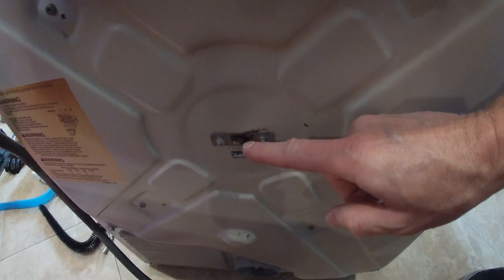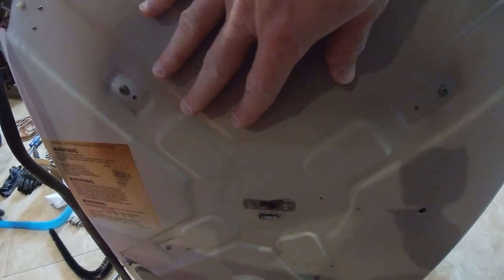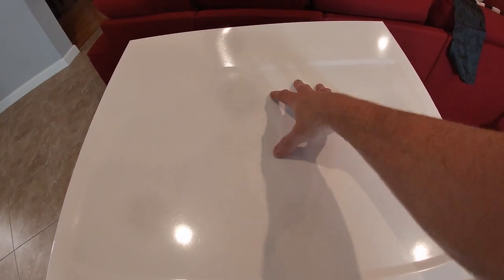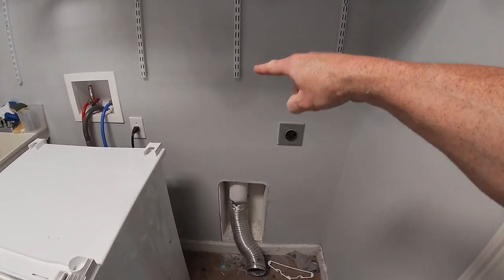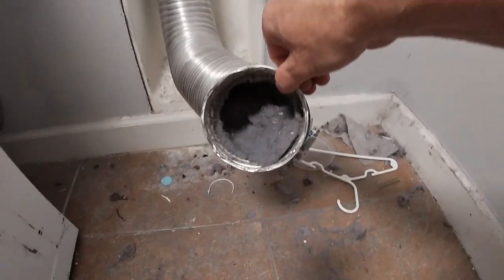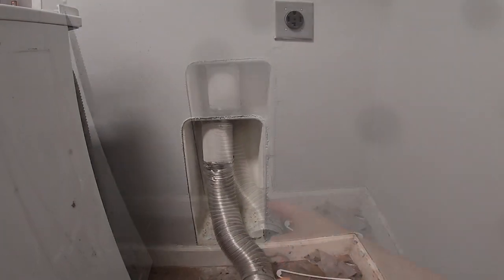It squeaks like crazy. If we go around the back here, you guys can see this is the back of the bearing. There's like a little ball bearing in here and all this black stuff is melted plastic that's coming out the back of the machine. This thing gets so hot when it's running you can't even touch it. In addition to the back being ridiculously hot, the top is so hot that if you were to put something on it, it would pretty much catch fire. Today's video is going to fix all of that stuff. The heat issue is mostly caused by the dryer vent - the tube here that goes up inside the wall has so much lint in it. It's pretty caked in there. So we're going to clean this entire thing out all the way to the outside of the house.